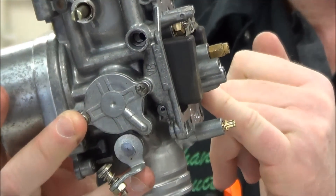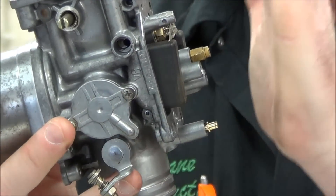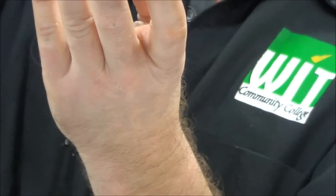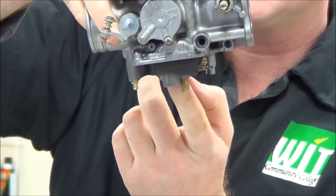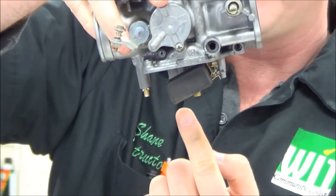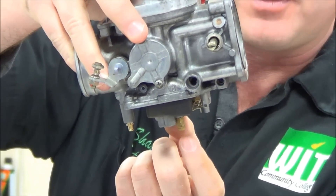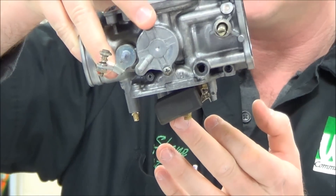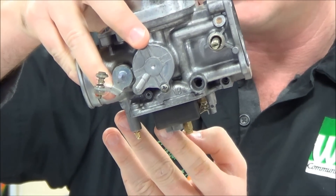The first situation I have demonstrated here is we purposely set this really rich. The float is actually bottoming out — it's physically touching the body. You can see from the relationship of this carburetor and this float that it's tipped in, or downward. Now, I'm going to flip this carburetor into a normal operating situation. What did we compare this to? A toilet. When you fill your toilet, water comes in and there's a float that shuts the water off. The further this float can come up into the carburetor, it produces a rich condition — we get extra fuel available for our jets. If it was set down like this, it would be a lean condition — shutting off fuel and not having enough available for the jets. That happy medium, or the specification in the manual, is typically parallel — 90 degrees.